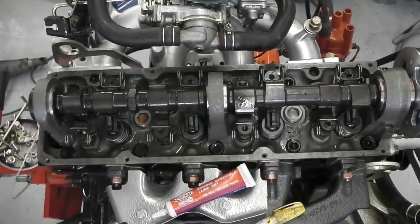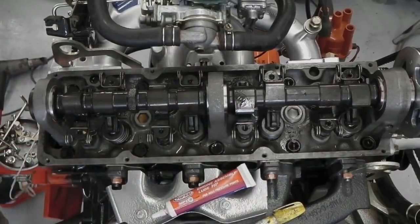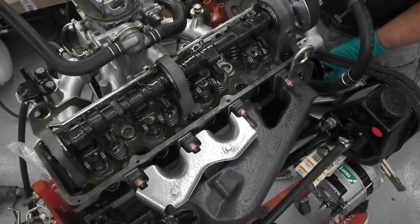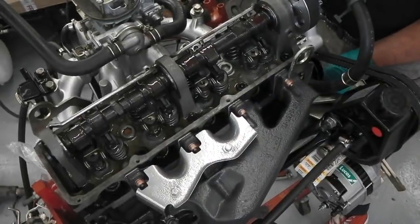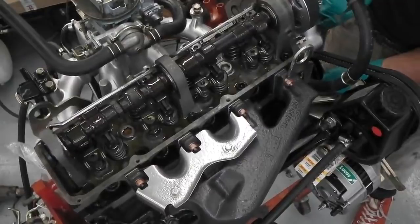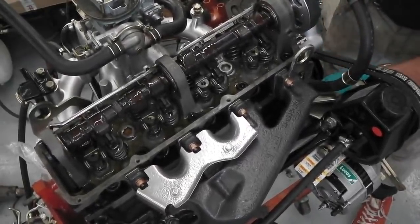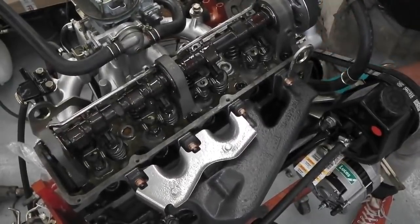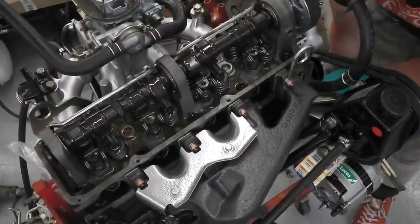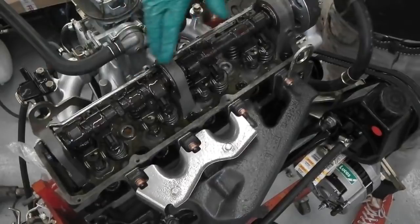I'm not going to film all that now. We've got six more to go. Wish me luck. Okay, that's all the clearances done. And now I'm going to put the rocker cover on, but we should just make sure, I've spun it up and you'll see we've got the spray bar on, and then just turning it, making sure oil is being delivered to all the spray bar points, so we're good there, we're primed up and good.